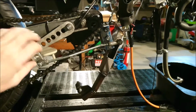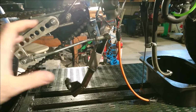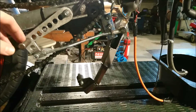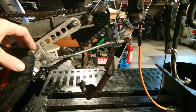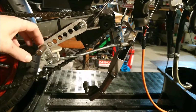So say you tune the variator so the engine stays at say 13,000 RPM while it's working through its range. With this lever I can apply some pressure and basically choose what RPM above that I can keep it at. So if you have good foot control, you can basically keep it at what revs you want. I'll talk more about that when reassembling it. That's about it. And as I said, I'll go more into detail when we start to reassemble the bike again.